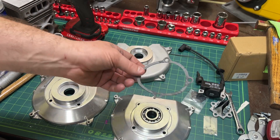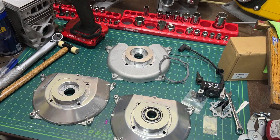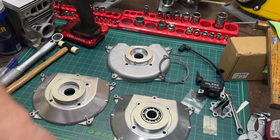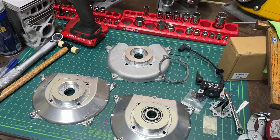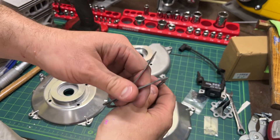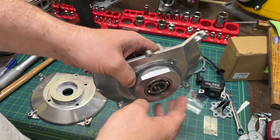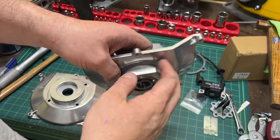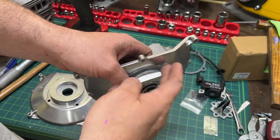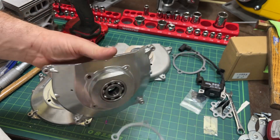The engine gasket sets come with these thin gaskets, and then there's a thick one. In a gasket kit there's a thin one and a thick one. Sometimes you can put the thick one on — that'll help like a shim to center your crankshaft, and also push it out far enough so you're not hitting and you're clearing. I tried a thick one and it still wasn't working.